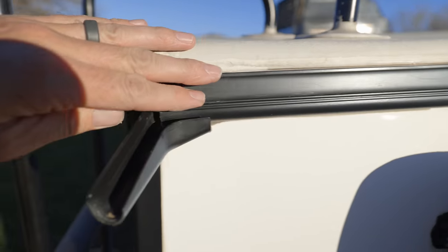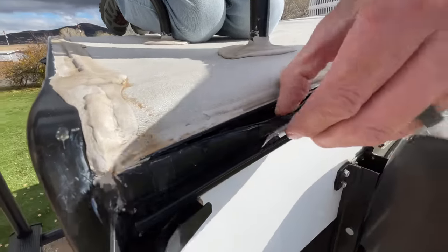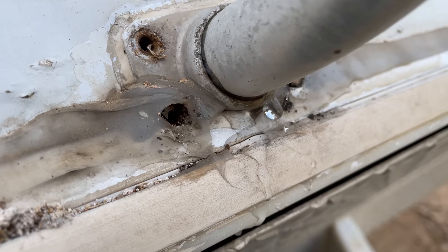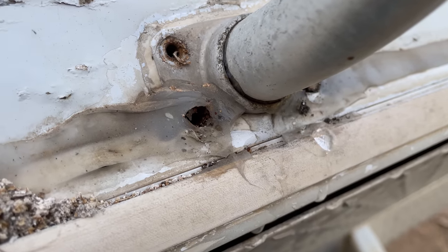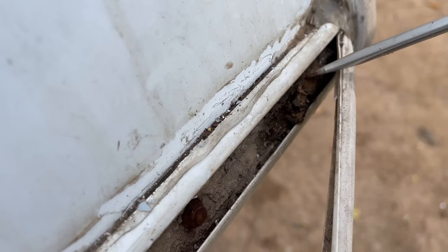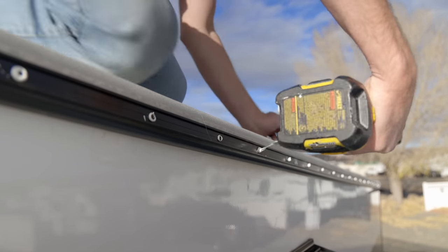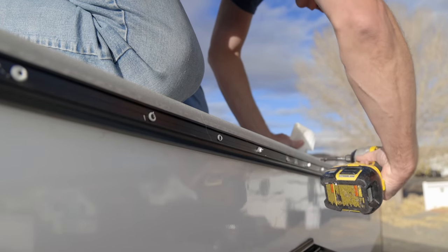This last one is a bit of an experiment and has to do with how water sheds off the roof to the sidewall of the RV. Most RVs have a trim piece along the outside that tends to catch and hold water against the screws in there, which can be a penetration point causing big problems. I just pulled a ladder off a trailer where it was holding water, starting to delaminate, causing rust and breaking down the wood in the sidewall — the whole thing had to be removed and replaced. That same issue applies to the transition from roof to wall. The track up there is held with screws, with butyl tape behind it for one layer of protection, but without an additional layer it can leak. So I pulled each screw out and put sealant behind it — sealant on the screw going through the butyl tape — giving it two layers of sealant.